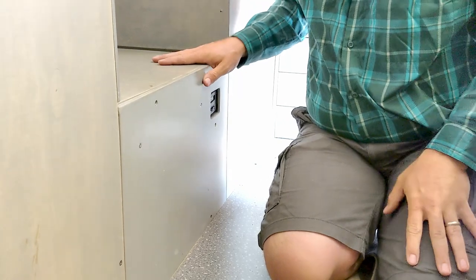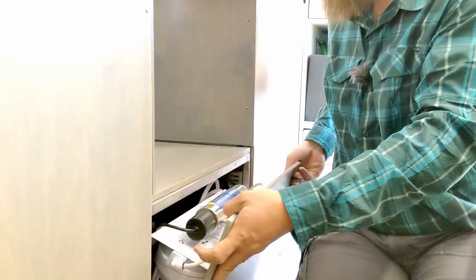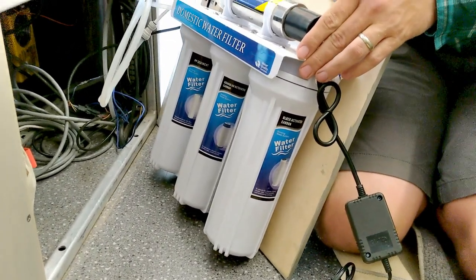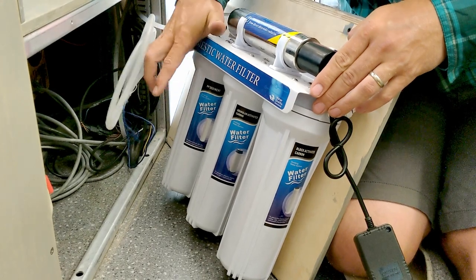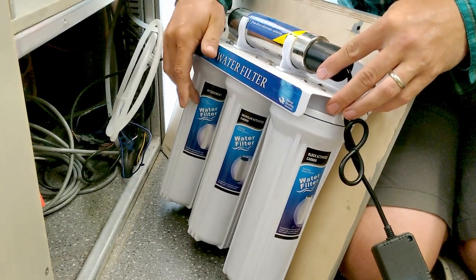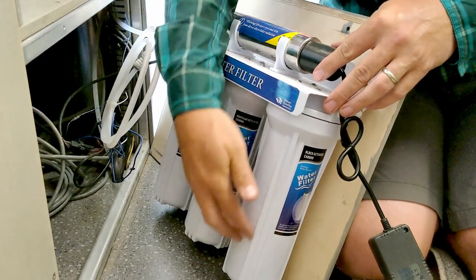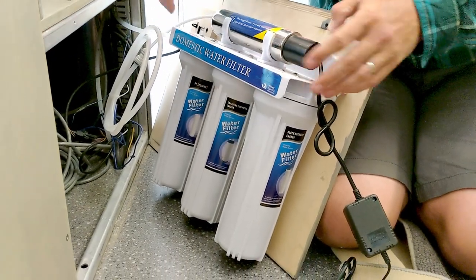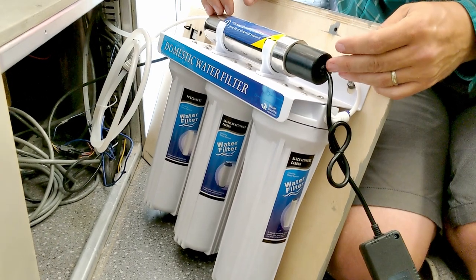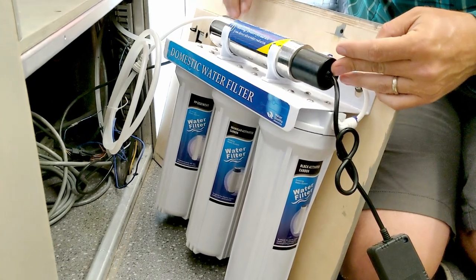Moving inside, this is our dinette floor, and behind this panel is where I've installed our water filter. This line comes from our Pepsi kegs, goes through a sediment filter — just a basic spun filter for sand and rocks — then through a granular activated charcoal filter, then through a block charcoal filter, and from there up into the ultraviolet sterilizer, which is a 6-watt UV light that kills all the gribblies that filters can't filter out, so it should be fully sterilized coming out of there.